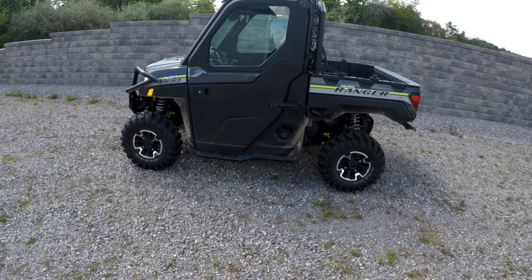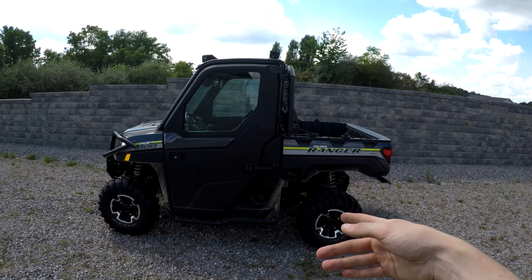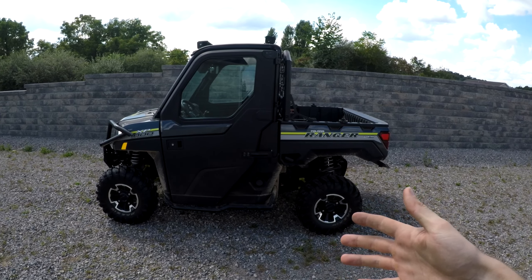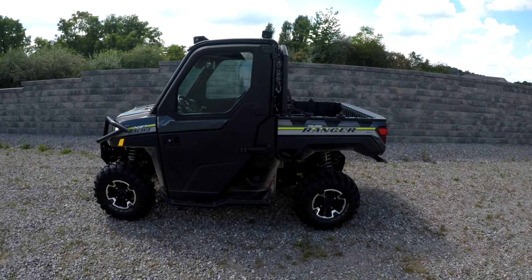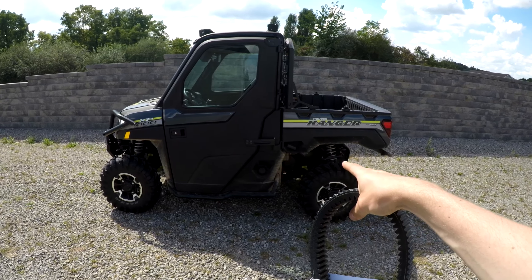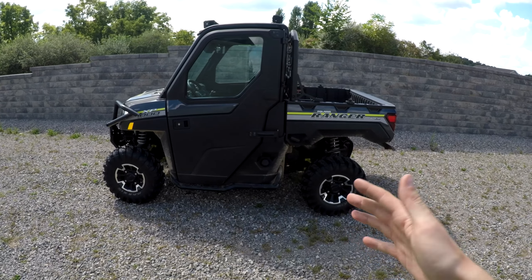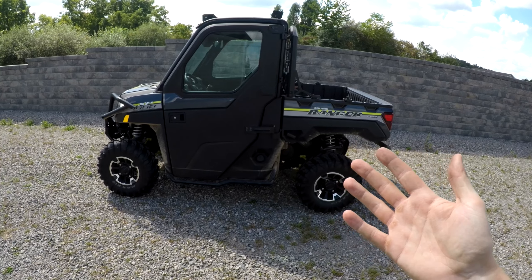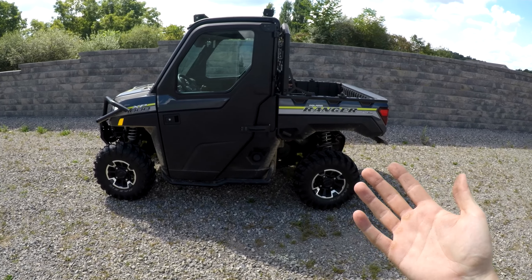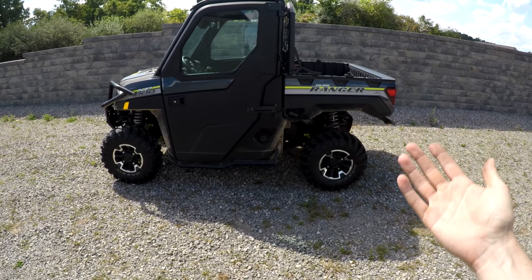First, we've got to take this thing for a before test drive. We've got to see what the maximum RPMs are at full throttle. We'll also test to see what the engagement is like at low speed — see if it's kind of slow, if it slips a bit. And once we get that, we'll go ahead and install the new belt and repeat the test. There is also a disclaimer: this is a brand new belt and the old belt has 600 miles on it. The numbers for RPM and engagement might change as it breaks in — max RPMs will probably come up a bit.